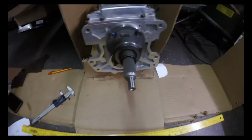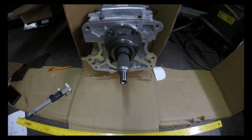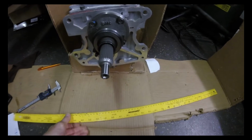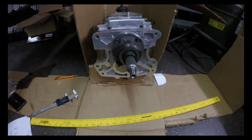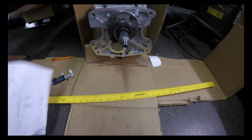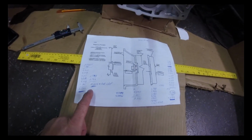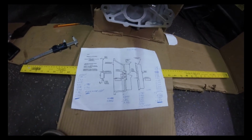So what I would do is put the shims in, measure 4 different places, and then average them, just because it's not an exact science, and even having the ruler tilted or whatever, it'll give you a little bit different reading. So try to do it as straight as possible. Took 4 measurements and averaged the 4. So where I'm at now is essentially a 0.224 air gap. 0.250 is a quarter inch. So I'm just shy of a quarter inch.